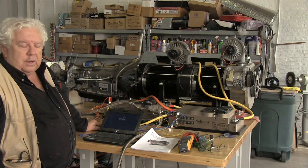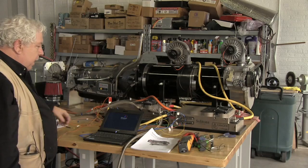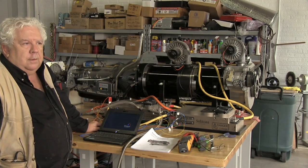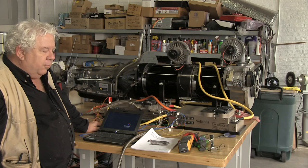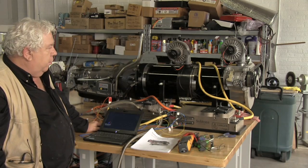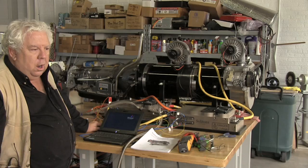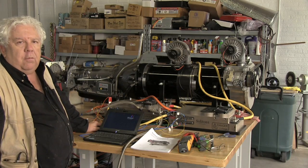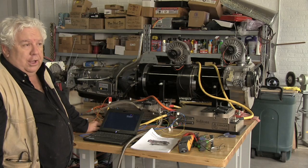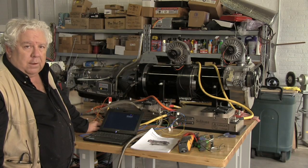And that would be 300 kilowatts. 300 kilowatts divided by 746 watts per horsepower works out to right at 400 horsepower, which is coincidentally the horsepower of the internal combustion engine that we pulled out of the vehicle. In general, if I can replace a horsepower with a half horsepower electric, I'll like the feel. And if I can replace a horsepower of ICE with a full horsepower of electric, I'll like the feel real good. And so we probably have a little bit more than we need to drive this vehicle here.